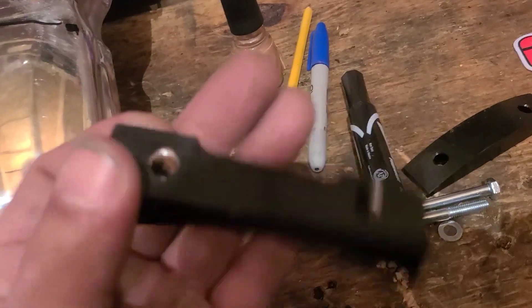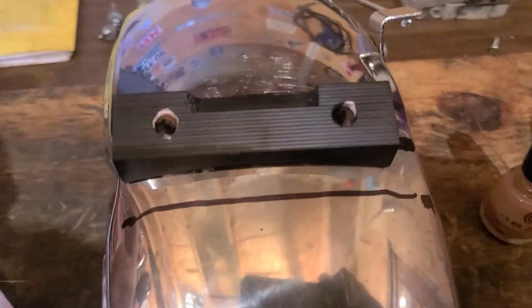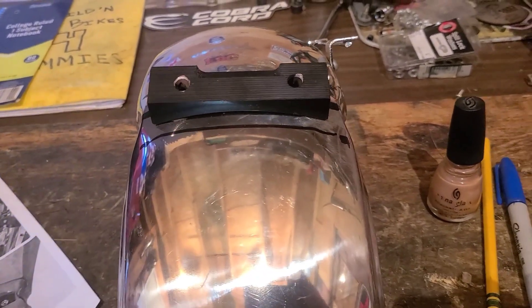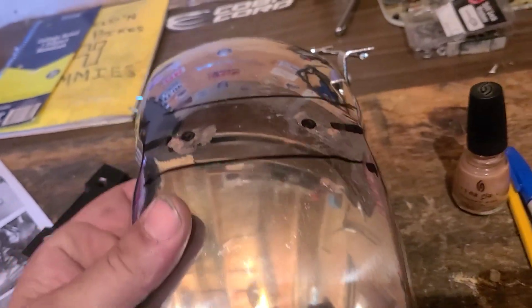A Sharpie marker worked, but only after I roughed it out with a little bit of nail polish — I found the centers and marked those. This CNC'd spacer has a little notch cut in it that goes towards the rear. We know the rear of the fender has that little plastic extension, so I lined the spacer up with the centers and then tried to center the spacer itself on the fender. Once I did that I just gave it a dab dab dab — you could barely see where the holes would be, so we got in there and put a more permanent mark on the surface. That'll all come off with lacquer thinner. These have to get drilled out now.